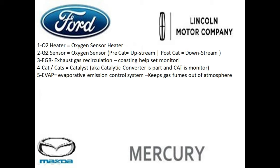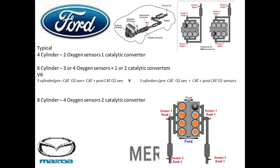After the oxygen sensor has gotten ready, the catalyst monitor on Fords especially will then get ready. However, if the oxygen sensor doesn't get ready, the catalyst normally does not get ready. And the last monitor to normally get set is going to be the Evap. And this can sometimes take a few days. And if you are testing your vehicle and it's taking longer than expected, be mindful of your gas level. So you might really have to go visit a gas station every other day to keep your fuel range between that 50 to 75% range for optimum chances that you're going to pass.